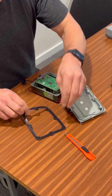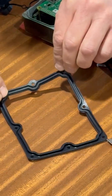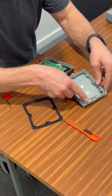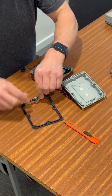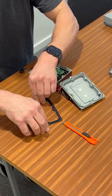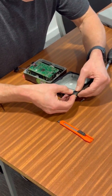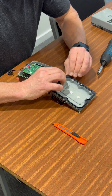Now the new seal has two sides to it and you've got to get the right side. On one side, both have an upright piece in it, but one side has a little indented ridge inside it. That ridge goes on the front of the case. So when you're putting the seal into the back of the case, make sure that ridge is up. The seal is not symmetrical, so the little indent down here needs to match the corresponding part, getting it both with the indent facing up and in the right orientation. You can see that it clips over the camera case.